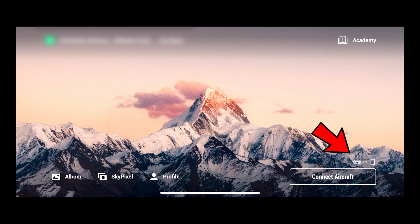You should see a connection icon appear when you open the DJI Fly app with the goggles powered up. Now if you're an Android user, do not use the USB-C cable that DJI supply in the box — I believe it's charging only and not charge-and-data. You need to make sure that your cable will allow charge and data to transfer. Use your own cable. If you're having trouble, try a different cable. One of the most common issues is people either using the wrong cable or using a direct cable without the OTG adapter.